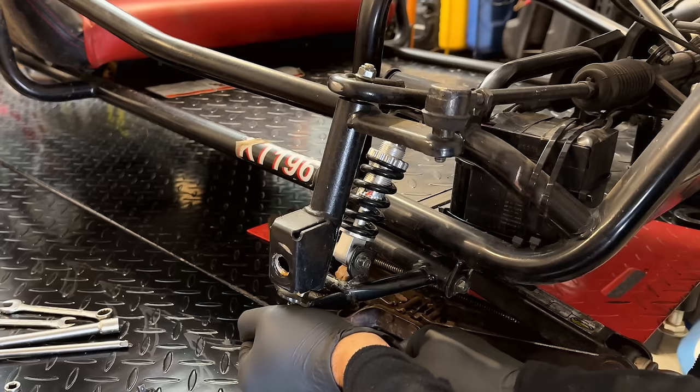So let's test my theory real quick. We'll put this in the neutral position, the middle, and we'll hook up a lead right here. I have the meter set to test continuity, so if a connection's made, it'll beep. We'll put one lead right there. The only time this should beep is when I flip the switch toward the black lead, and we get nothing. That's not good. Let's try start. Okay, and we get a connection there. So maybe it's not intuitive, but hopefully it's what I think it is.